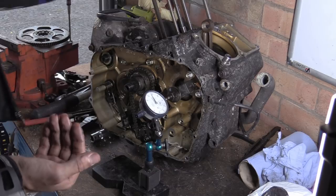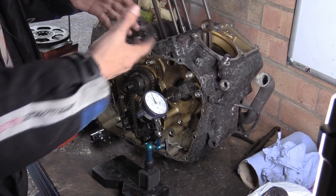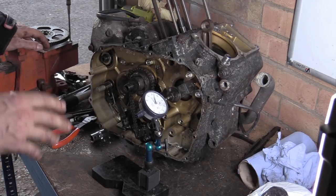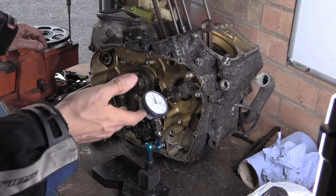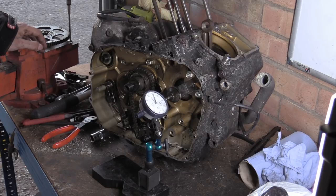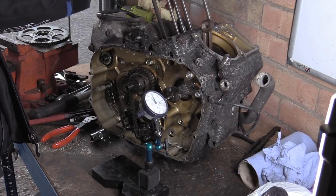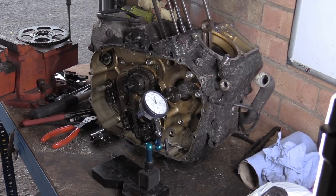Then when you move in, if I move this engine like I can do here, you see it's rocking and rolling, then the plate will move with the engine. We'll go through that on my first engine rebuild, where I'll actually spend more than 10 seconds setting it up, but it's just to give you an idea. Is that a lot? Well, I don't trust this. We've read 40, maybe nearly 50 microns on this. I don't trust that number because my setup's all over the place. I can get that just by doing that, or even pushing backwards and forwards. I can get whatever.